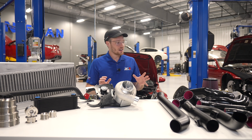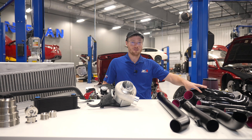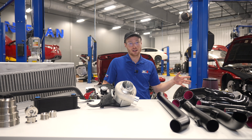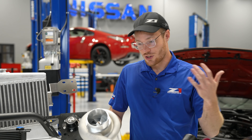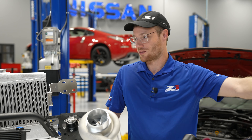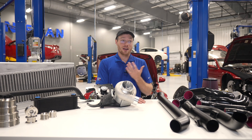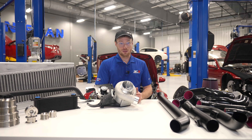Following the air, we start with the intake. We include a full three-and-a-half inch filtered intake. Unlike other options, there's no reason not to run intake — this costs only one horsepower at the full-send setup. A full filtered intake will help prolong the life of the blower and your engine and makes it more street friendly.